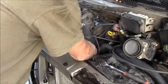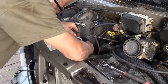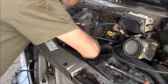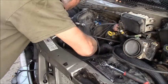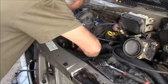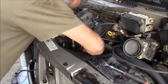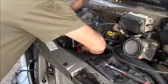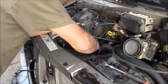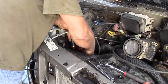Now I need to leave a little straight space on this. Good thing I got this mini cutter. This is aluminum pipe — it cuts really easy. I'm going to blow these lines out now before I put them back together so I know I got all the junk out of them. The other one I'm going to have to cut with a hacksaw blade because I want to keep it real short and close to the connector so I can fit my fitting on. I already traced it out — I crawled around under the van and looked.